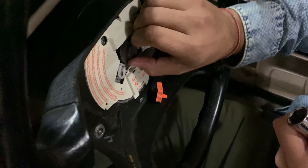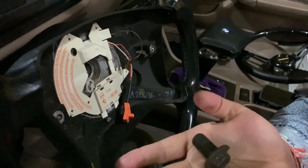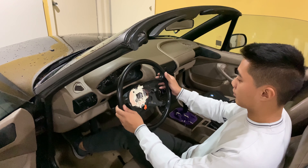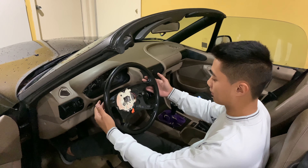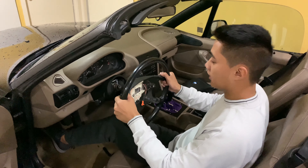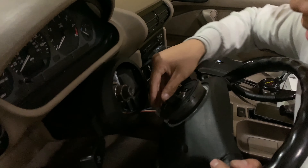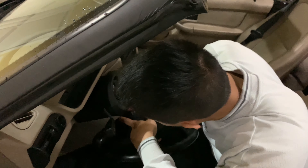When that middle piece comes out, make sure that before you actually take it out, your wheel is completely centered. When you take off the wheel, just be careful because some wheels will fly out at you. This one actually seems like it's going to come out really easy. Just do a little backward-forward motion like that, and it should come out. Once it comes out, there's gonna be a wire here connected to the steering wheel — you're just gonna wanna pull that out.